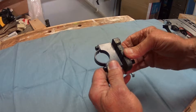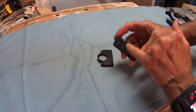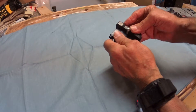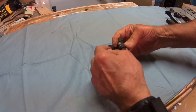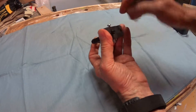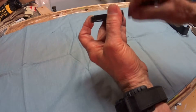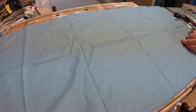In the back of this piece of puck I made it thick enough that it would stand off the right distance between where my pedals went around, the magnetic pickup, and the down tube. With my bandsaw I cut another hole in here big enough to receive this, but not quite enough that it would fit all the way in — just so there's a little bit left so when I squeezed it here it would hold it in place. It's threaded and sits on the down tube of the mountain bike. The magnetic switch sits on the bike vertically and has a little hole where you can put a tie wrap around it.